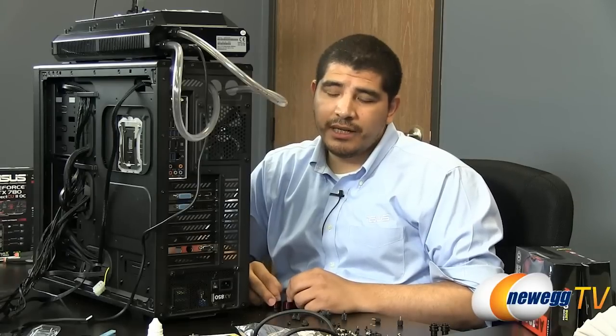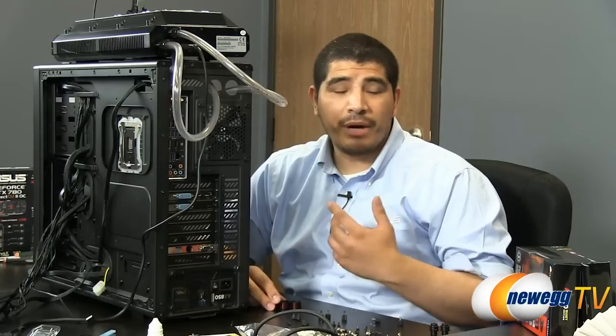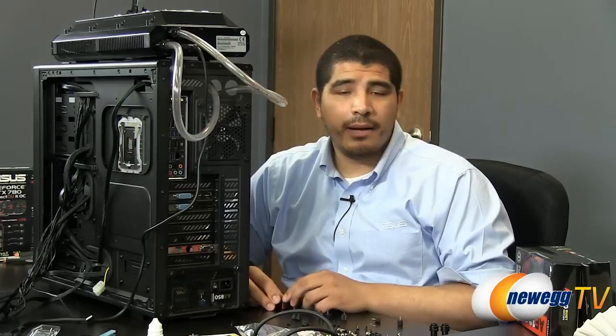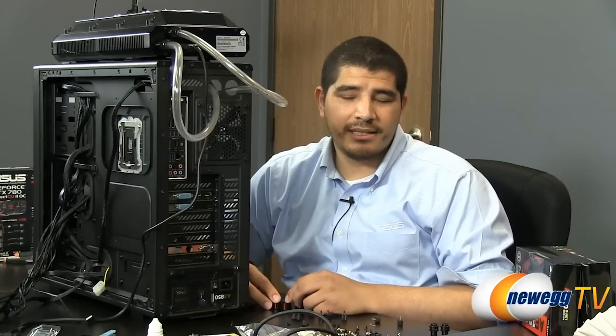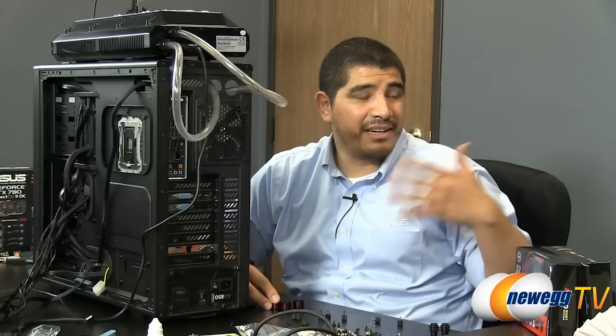Possibly. I will tell you that Asus knows, through a long amount of RMA analysis, the most common point of failure for a motherboard is due to brownouts, surges, spikes, and sags. So abrupt power surges, spikes, and sags can reset your board to a default parameter of operation. This could potentially be an indicator that you have dirty power coming out of your power line. A lot of people don't realize that most surge protectors just use what are called MOVs as a form of protection. These have a finite amount of times that they can run. So if you've had your surge protector for like 5 years, it might not actually be working anymore. It could just literally be a big outlet.